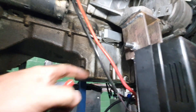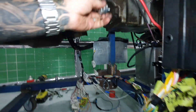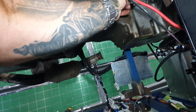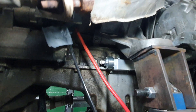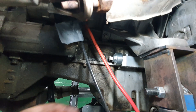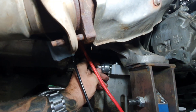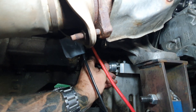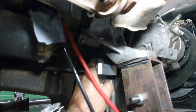As you can see, there's the block up inside there. Here's my knock sensor — they come with a little protective thread protector on them. I'll be running these ones at the back like this so they don't get directly exposed to water hitting them head on. You screw them in like that and tighten them up — that's on the driver's side, behind my air conditioning pump just behind the engine mount. Really easy to put the sensor in but difficult to get to — I used my ratchet ring in there, and you can see a bit of a mark on the back where it got stuck and I had to beat on it to get it out.